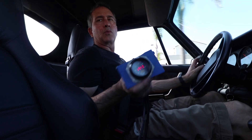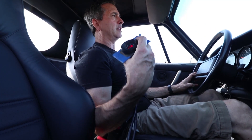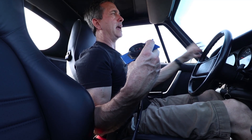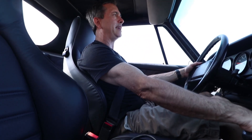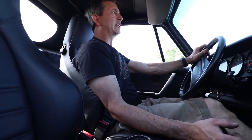I'm also running around with this gauge plugged in. If you're not familiar with these gauges, this is an air/fuel ratio gauge. Any high numbers mean lean — anything over 14.7 is lean, anything under 14.7 is rich. Max power occurs somewhere between 12.8 and 13.2.